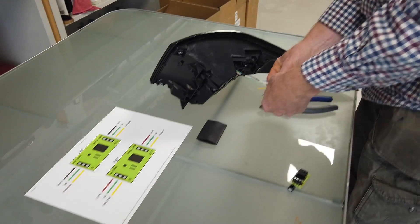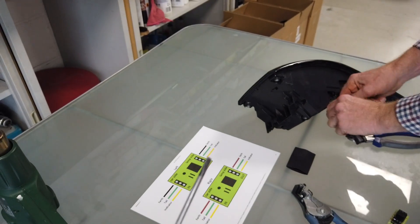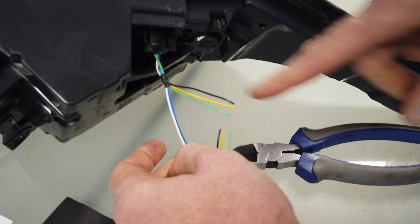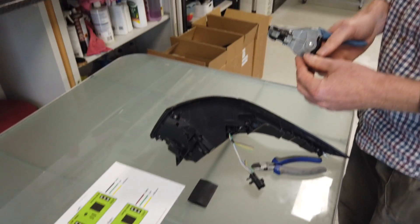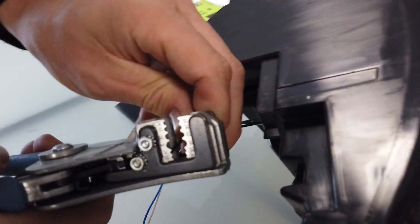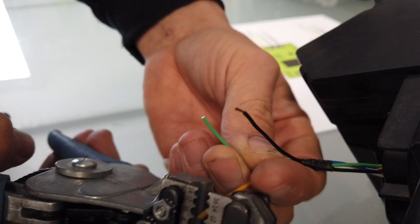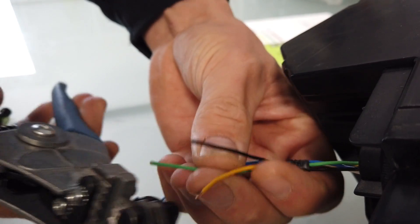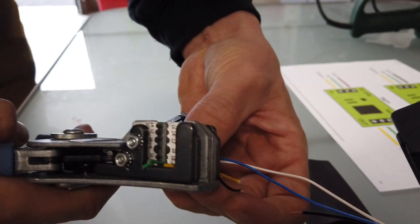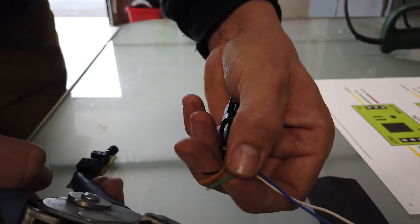For this you're going to need some snips, some wire strippers to take the insulation off the ends, and a small flathead screwdriver. If you're really keen, once you strip the wire you could tin the ends — we'd recommend soldering them. It stops the copper oxidizing and going green, gives you a more solid cable so you don't end up with a bunch of strands trying to make the connection.